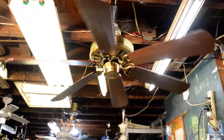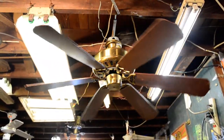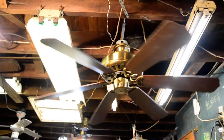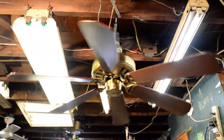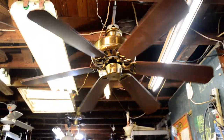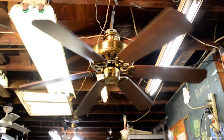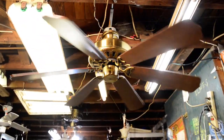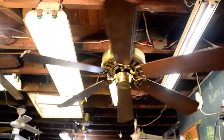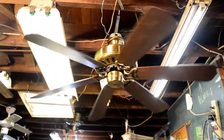Now, when they introduced the newer flywheel, the one that breaks all the time, they made it with symmetrical screws, so it would be 4 or 6 blade compatible. The early ones were only 6 blade with offsets, with asymmetrical screw holes. This one, again, is 6 blade only because it has that good rubber flywheel. The metal flywheels previously for the Superfan 3s and 4s, or at least the 3s, were the same way. What I find interesting about the 6 blade irons is it looked like they were really designed for 4 blades on a smaller flywheel, but then I guess they changed their mind but didn't want to change the design of the iron, so they just stuck with it until about 85 when they switched to the symmetrical pattern. I could be wrong about that date. Someone correct me if I am wrong.